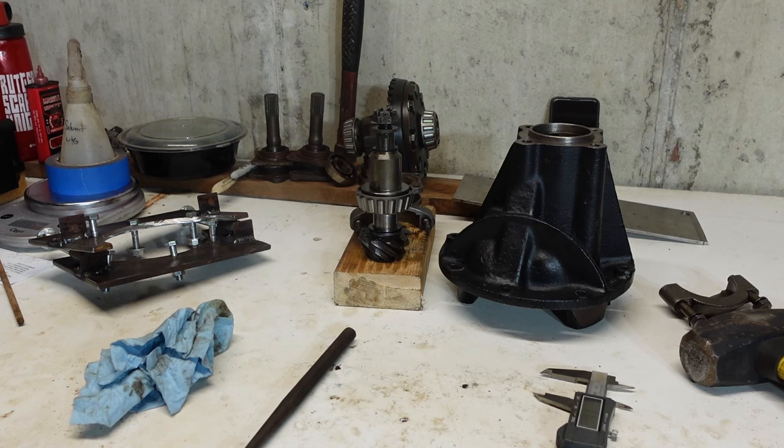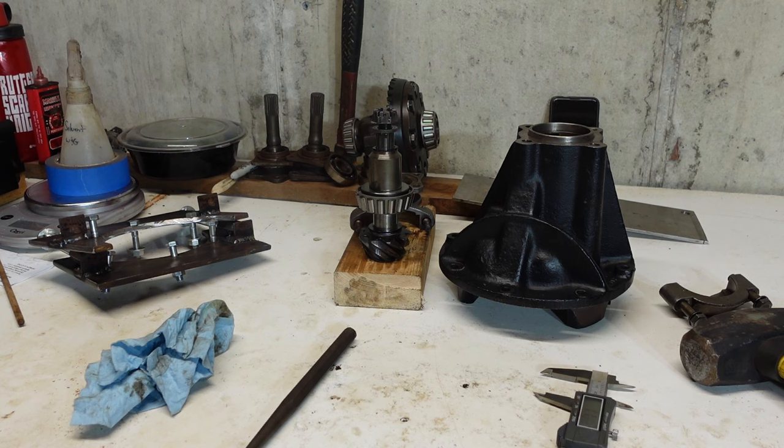Got that bearing off without causing any damage — saved myself about 30 bucks. Did notice some damage on the inner diameter of the thinner shims. Don't know if they went in crooked — it doesn't tell you to sandwich the thicker shims on the outside of the thinner ones; maybe I should have done that. I took my pinion height again and got about two thousandths different than I got last time, so I'm a little frustrated — I don't know what's going on with that. But this is how you kind of do it. We'll get these shims on hand and re-engage when we get them.